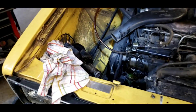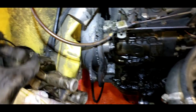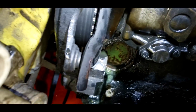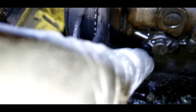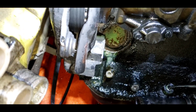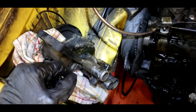So we're working on our Rabbit water pump. I've got the pump out of the car now. It wasn't too hard. I don't think it's ever been replaced, and I don't think this seal looks like it went bad. I've got this o-ring that seals to the block. You can look down in there, and there's a stain at the bottom. I don't actually think the water pump itself failed — I think the gasket between the block and the water pump failed. It's pretty grimy, pretty greasy, but it's probably time we change this out. The original water pump — Volkswagen did a good job.